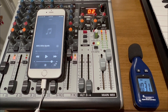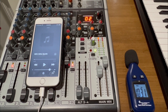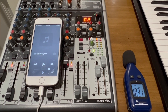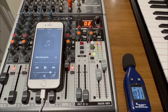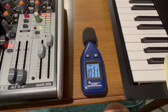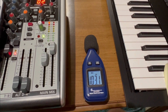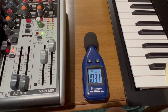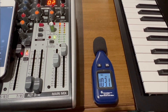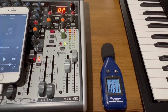That's a pretty dynamic track, and I'm playing in a wide-open space in the home here. I'm sitting back about two and a half to three meters — I haven't measured exactly. I haven't compared it to the Everse 8 or the Bose S1 Pro Plus yet, but let's see what we got: 103.1 dB. I can guarantee that the Everse 8 or the Bose S1 Pro Plus would be about 8 dB less — that would put them at about 95 dB — which matches my other testing. So this is pretty loud.